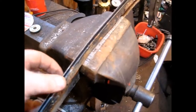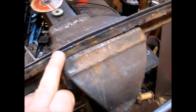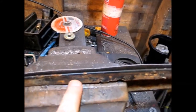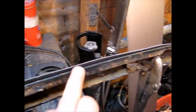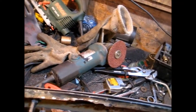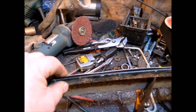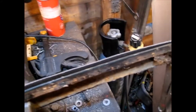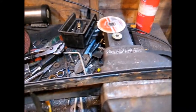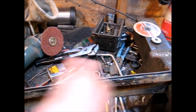What I'm doing now is I've cut this piece here to the shape of the back of the boot lid. I'm going to fasten it in the vise and clamp it into position to the exact shape of the piece I cut off. I want to go across it with the angle grinder and cut it to the exact profile. With the jigsaw you can't get it perfect, but by doing it this way I'll be able to get a perfect profile.